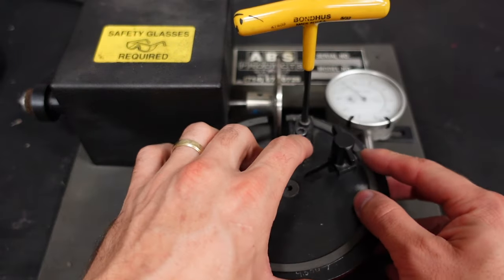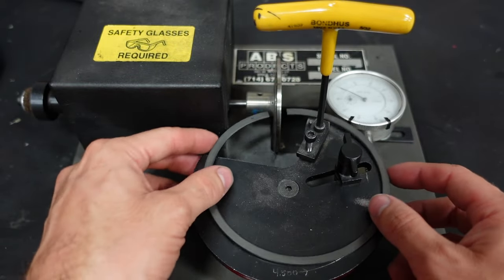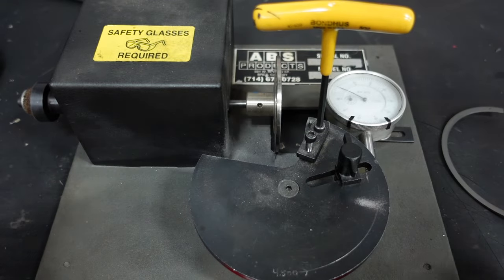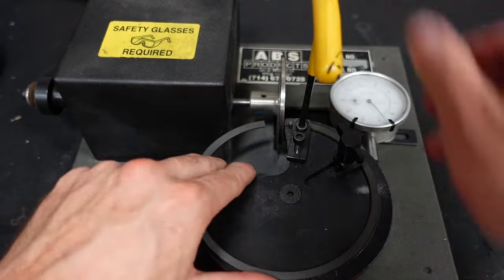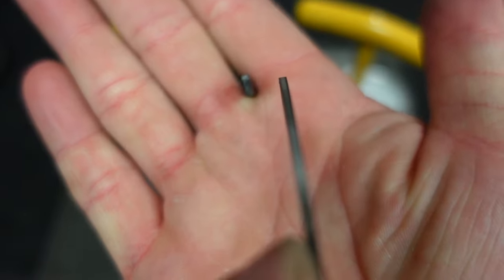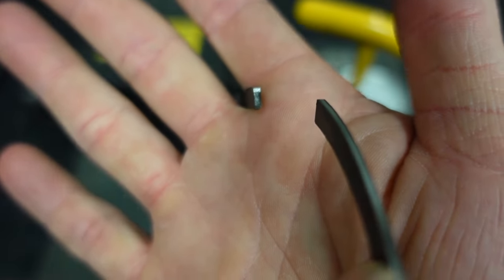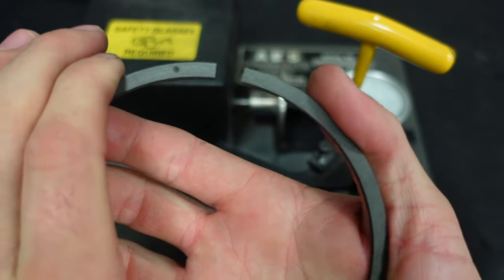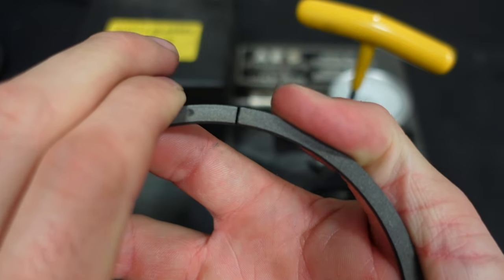We need to adjust this ring filer to fit this ring diameter. When the ring filer is cutting, we don't want it cutting at an angle — we want it cutting extremely square. That's probably the most important thing in this whole process besides the gap itself. I have my ring in the filer and if you look at this ring, you can see the shiny part is just the very tip of the ring — we're only cutting up top and not in the middle or the bottom. We want to make sure that before we take any cuts we have a clean sweep across the full face of the ring. You always want to cut one side and one side only, because this is your reference to keeping that gap nice and square.